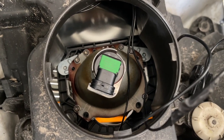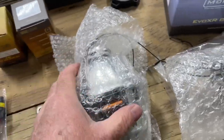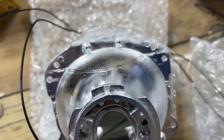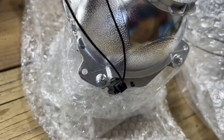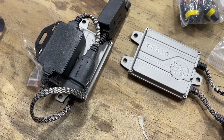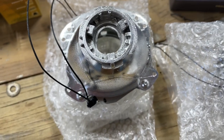All right, that's what we're replacing right there — the actual reflector housing, six bolts. What we're going to do is install these. These are Morimoto's, and as you can tell, same bolt pattern so it fits right in. The little wire right there is because it's a bi-xenon HID light with a GTR lifetime warranty ballast.